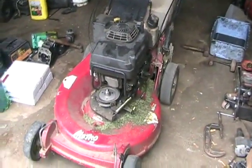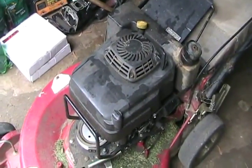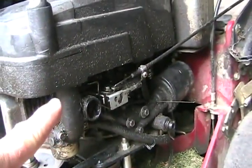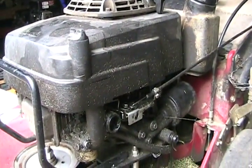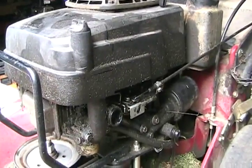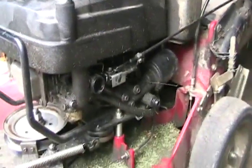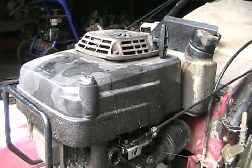Here is a commercial Kawasaki lawnmower and it's got a motor problem. It's running fine, but these engines are kind of unique and they have an unusual problem. It's hard to see until I get the plastic cover off. To split the crankcase open and get inside to all the piston, connecting rod, and crankshaft workings, you actually take the top off the motor. So to service the motor, you don't even have to remove it from the deck. It's so nice — I wish all lawnmowers were like that.